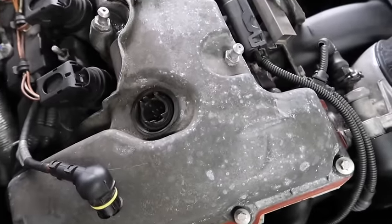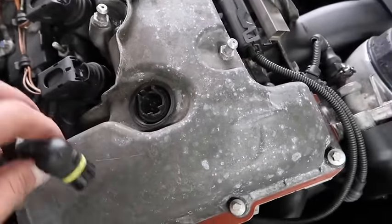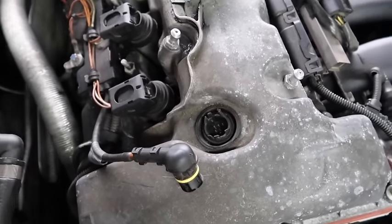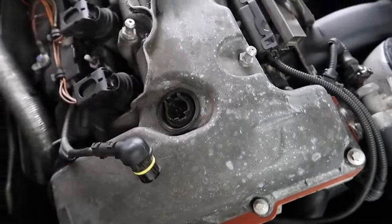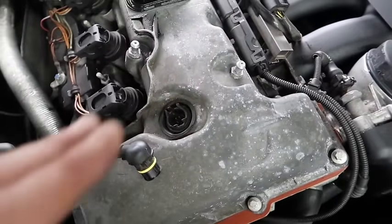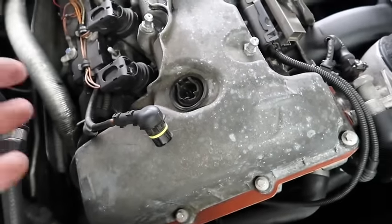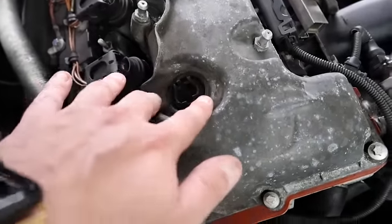The whole idea of this sensor is to keep the idle very smooth and steady at idle and to help advance the timing. It's all computerized — this cable runs back to the DME and links to the Valvetronic motor. Together, in sync, they advance the timing on the eccentric shaft when timing advancement is needed. If it's not corresponding correctly, you'll end up with lumpy idle, bad timing, and the car running rough.